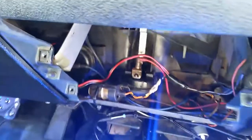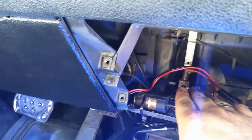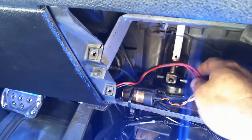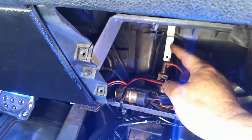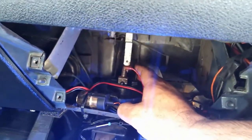I replaced that hose, and then checked everything out. This knob right here wasn't even going down — it needs to go up and down to control airflow. Because of that, I had no air coming in at all. Now I do, and this actuator goes down to open the main vents and blow air.